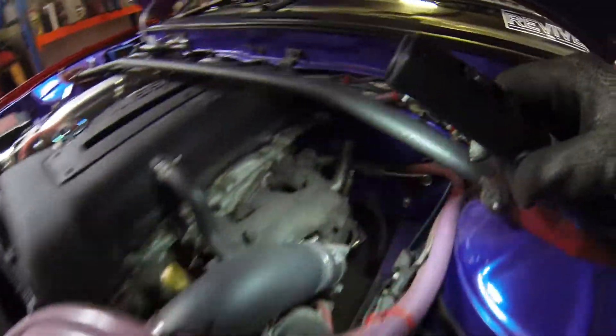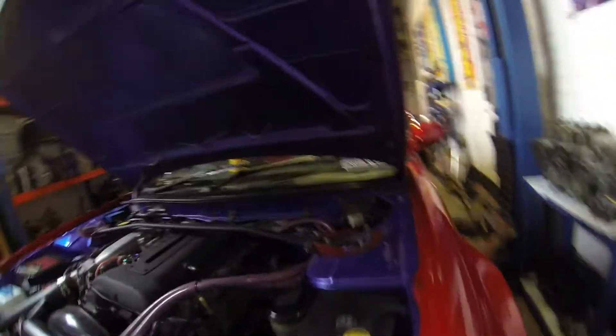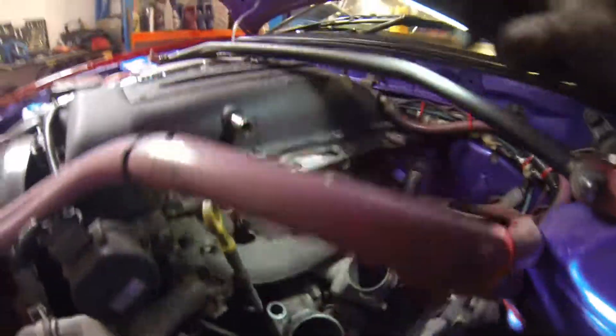Going to get them off there. Ignore him — camera off, come on. Just unplug this, jubilee clip on that, jubilee clip on the turbo, one of the intercooler pipes before leaving there. Then pulled the vacuum pipe off the boost controller — which might be your stock one. And then we look like this.